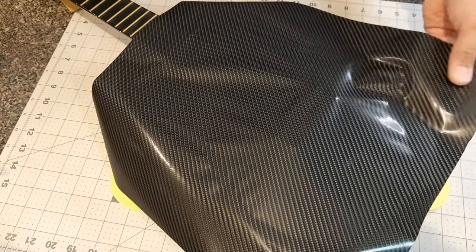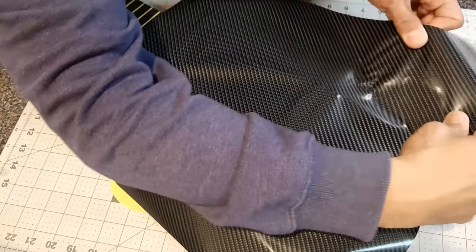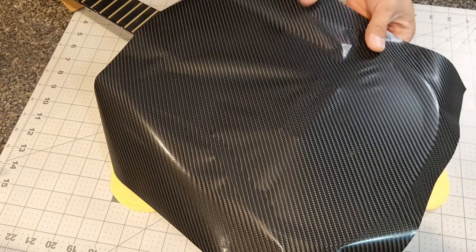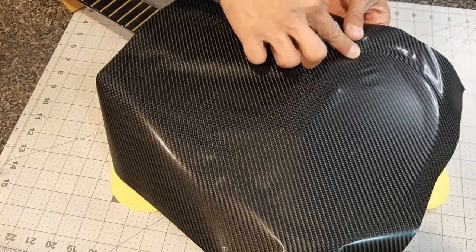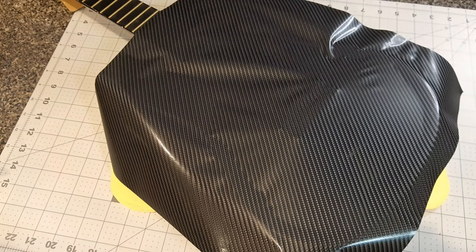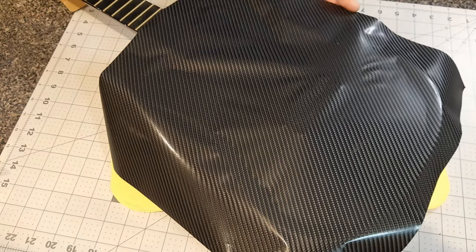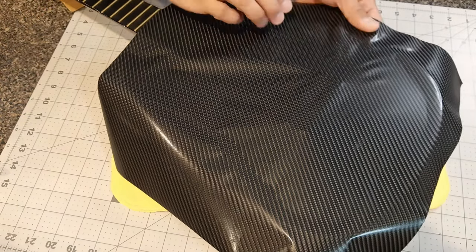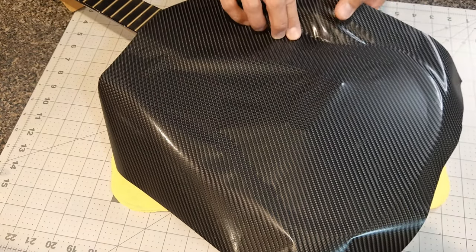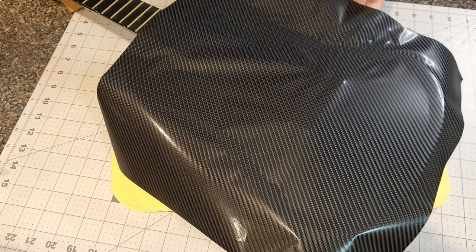You can see I'm working the vinyl, heating it as necessary — just warming it up slightly, lifting it up, and pulling it out in two different directions to get it nice and taut. This technique is called glassing out the vinyl — making the vinyl look like glass or smooth before laying it down. Adding a little bit of heat softens the vinyl, but it also shrinks it a little bit. Because the reason it's wrinkling is there's a little too much material bundling up. So by adding a kiss of heat to shrink it a little bit, that helps eliminate some of that excess vinyl so it will lay down smoothly.